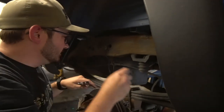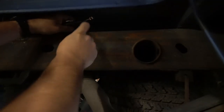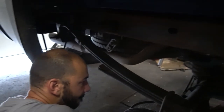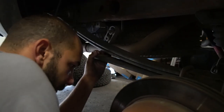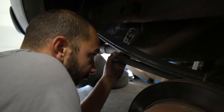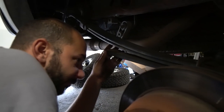We're pulling off the rear brake line hanger so that it has room to move. The leaf goes on the bottom end — it goes between the flat one and the one above, on top of the overload spring. And we got new U-bolts too? Nope, should be able to reuse them. Sketchy — that's what they all said.